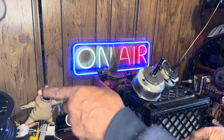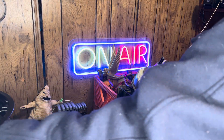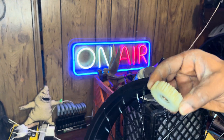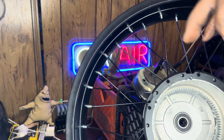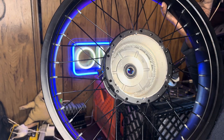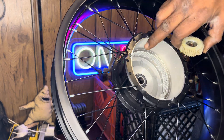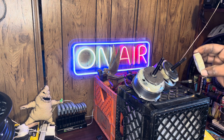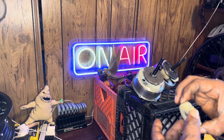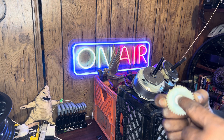The metal gears are a no-no for these geared hub motors. Do not put metal gears in here. Because when you hit something hard, instead of that gear breaking — which is designed to do that — it'll tear up your rim. You're going to spend probably $100 just to get that motor part. If you tear those gears up, it's done — there is no repair for that motor. You can get the smaller components like the clutch and these nylon gears, so make sure you're aware of which number you're ordering.